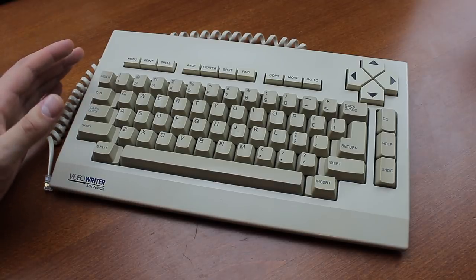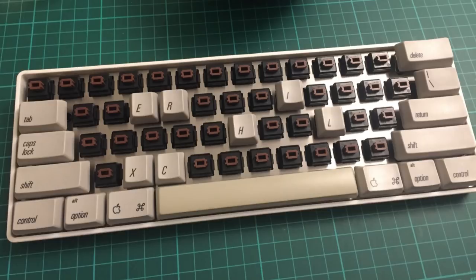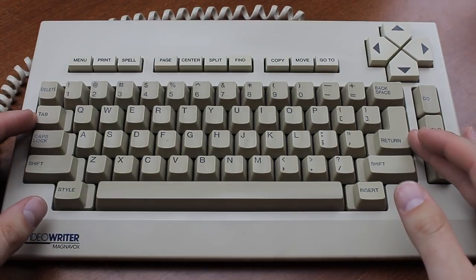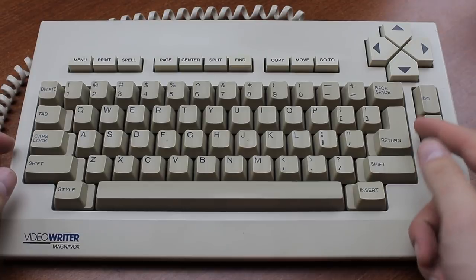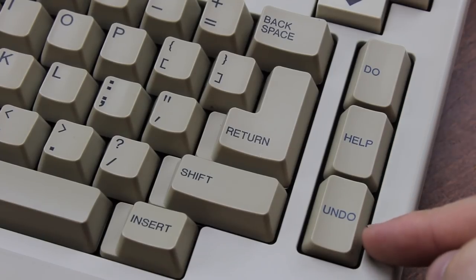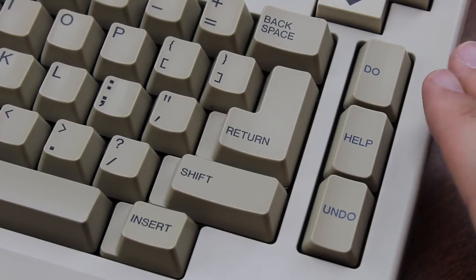Because the two main sources for these switches are both space-saving keyboards, brown Alps are often used in 60% builds. You could use the alpha caps for them just fine, but almost all the other caps are actually extremely non-standard. For one thing, the caps on the sides are all stepped, which also means the mounting point is in a different spot, and the caps on the right are additionally half a unit shorter than normal.